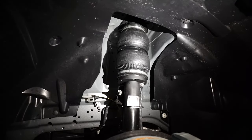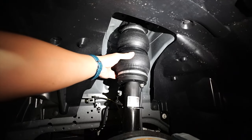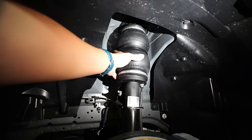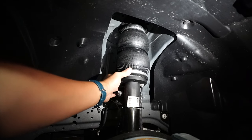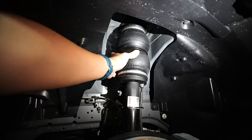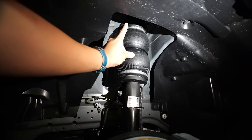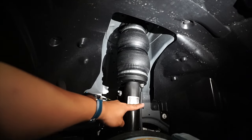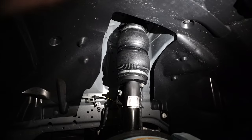Nothing much else changed from the previous video. Still the same McPherson-type strut from the Mark VI first video. Still the same bag — the 5814 Air Lift airbag, a double bellow. We call this 'the fat.' That's the code: 5814 Air Lift. So the only change from the previous catalog video is the shock bearing. The hose line routing underneath is the same. Let's move on to the back side, where we actually have a significant change compared to the first catalog video.